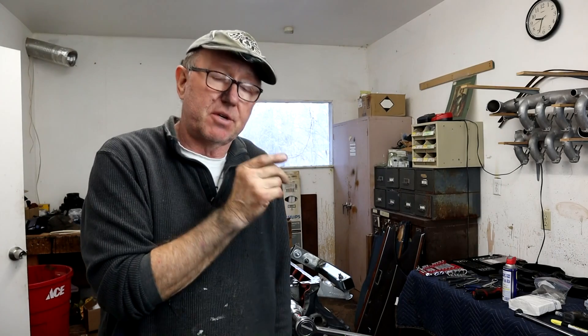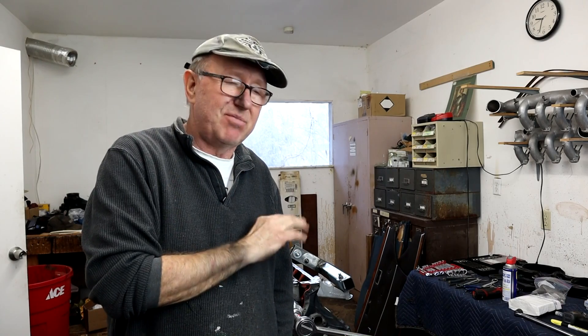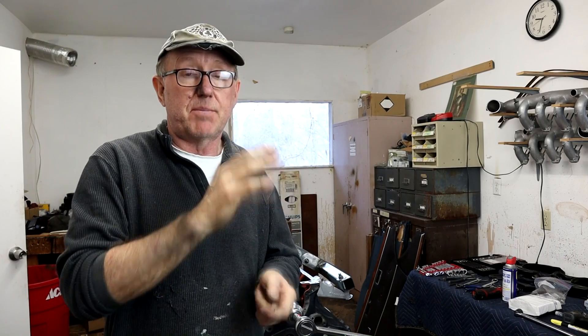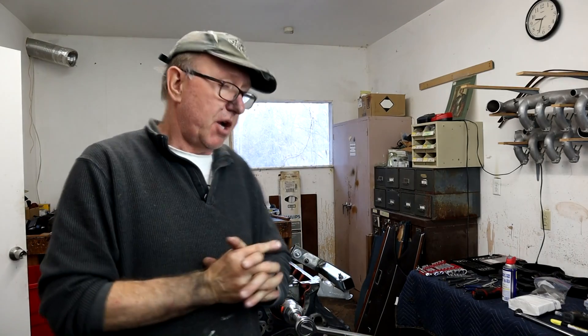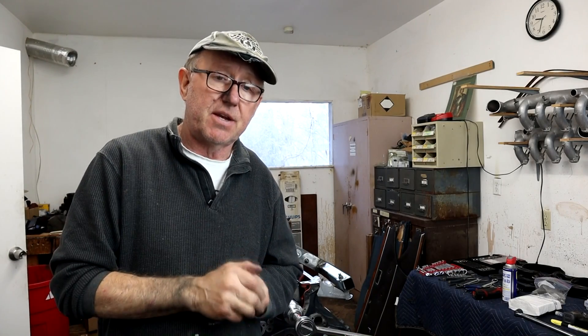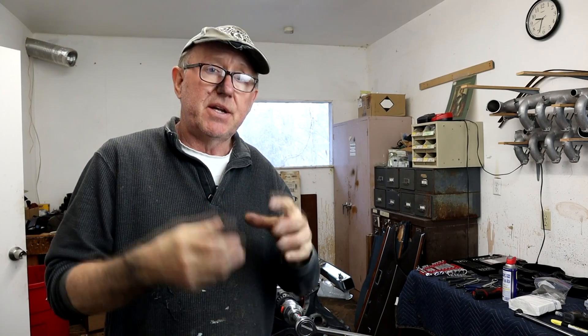Welcome back to the channel. In this video I'm going to show you how I put the pistons on the rods, lubricate them, and get them ready for installation. I'm going to do a dummy build to check our deck clearances — put all pistons in, crank them down with just a light oil on the bearings. We want to measure the piston-to-deck height; we've got a range of 0.35 to 0.70mm. Then we'll dismantle it again, check our clearances, clean all the journals, and do a final build. In the next video I'll show you how I end-gap the rings, install the rings, and the pistons go in for their final time.